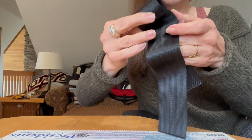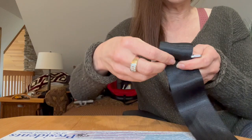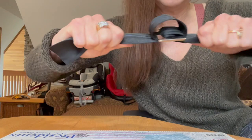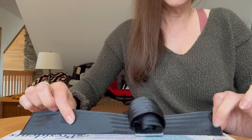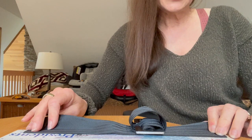We're taking that loop part to do a locking step. Right now the belt webbing could slide, so I'm going to take part of the loop, bring it over the top, and thread it through the fingers. Now my lopped-off part has been locked into the belt shortener as well. This is a very strong and approved way from the vehicle manufacturer to take one of their belts that is inappropriate for holding a car seat and make it the right length to hold a car seat.